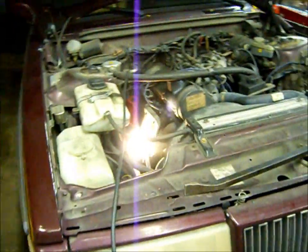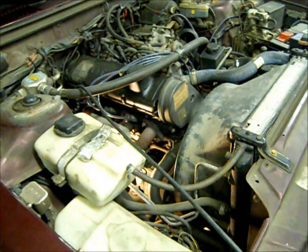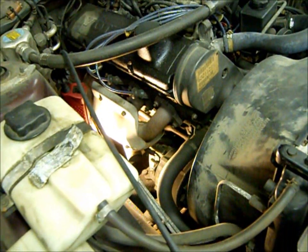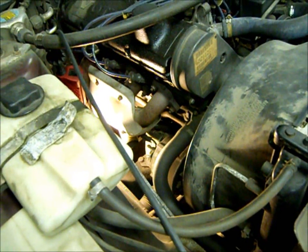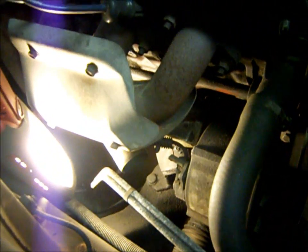And originally we thought it was the center bearing of the drive shaft hitting the floor. But when I looked under there, that looks nice and fine. It's good and tight. But I did notice the U-joint at the rear of the transmission sit in the floor, and the motor seems to be cocked over. So I did a little looking, and it seems like the motor mount's busted.